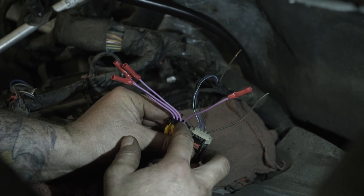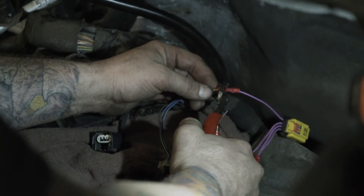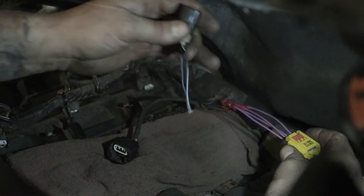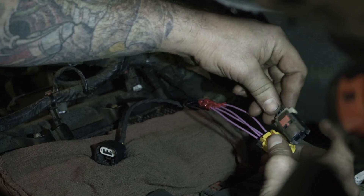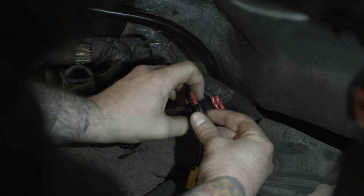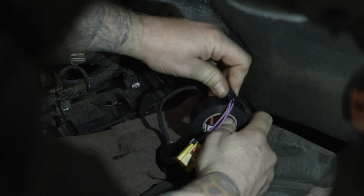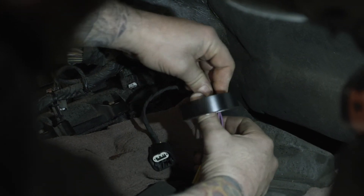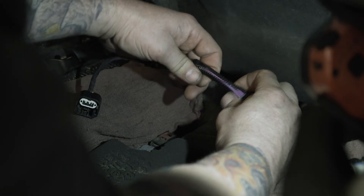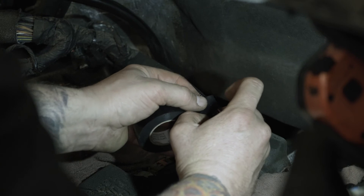To make sure that you match the new wires to the corresponding ones in the original harness, cut and repair only one wire at a time, working your way from one end of the connector to the other. Wrap the butt connectors in wiring and electrical tape to further insulate the wires from each other and to prevent moisture from easily entering the repairs. Install the protective conduit over the rest of the wiring and secure it with electrical tape.